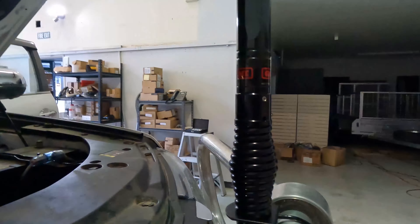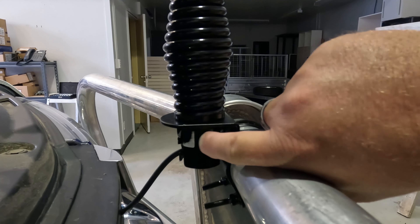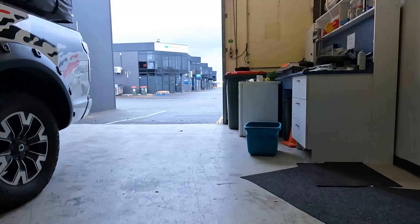There's my bull bar mount from Super Cheap Auto. I did have to trim off the top — the thread came out about another 20mm on the U-bolts, so I cut them off with a hacksaw. No big deal. With them there it wouldn't allow me to mount the GME antenna through the mount, so simple fix. I drilled a small hole through the radiator grille big enough to fit the plug through — because it's RF stuff and you don't want to chop the plug off and have to re-terminate it. The cable comes down behind my battery and heads towards the grommet that goes through the firewall.